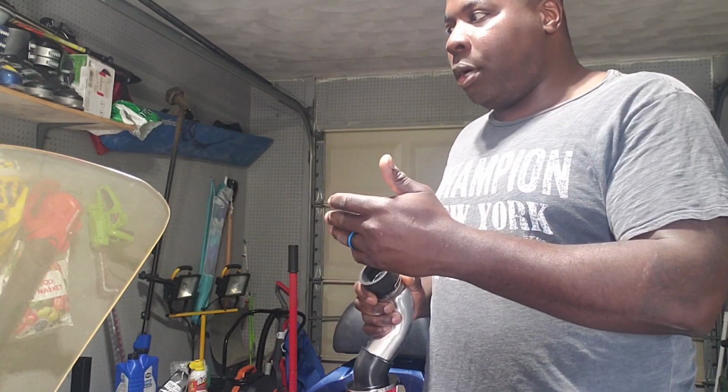It's at a 112, and it's an itty bitty little jet, and I can't interchange the parts inside of the carburetor. It's set to a certain thing, and I can't change the main jet holder, which is that little copper piece that goes in it, and then you put the jet on top to tighten it. It doesn't work, and I've taken off the nib one and stuck it in there, and the nib is too long. It would work if I could shave it down a little bit, or if I had a bigger bowl cap, I could stick it in there. And then I could use whatever jet I want, and we'd be good. But that's the problem. So right now I'm researching and trying to find some different kind of main jet holders, the little copper things.